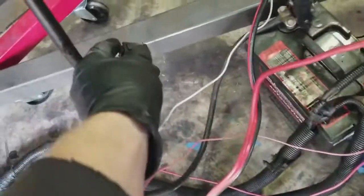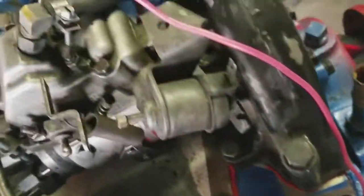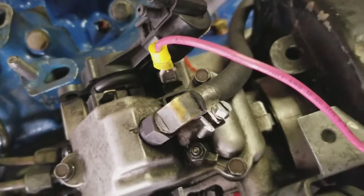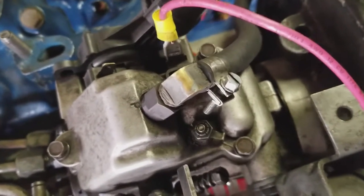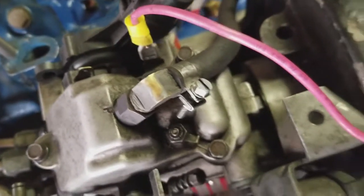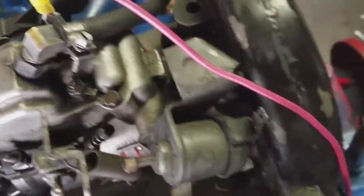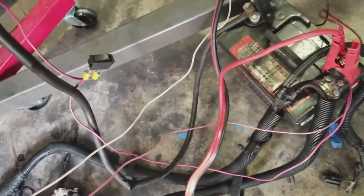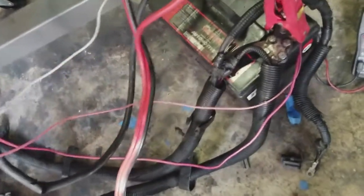There are also some other wires you have to use. First thing is, you need a switch or some sort of way of cutting power to the fuel solenoid, and that's right there on the IP. You've got to power that — you can't start the engine without powering the fuel solenoid shutoff. That'll open up the flow into the IP. I've got a switch there that goes to the power.